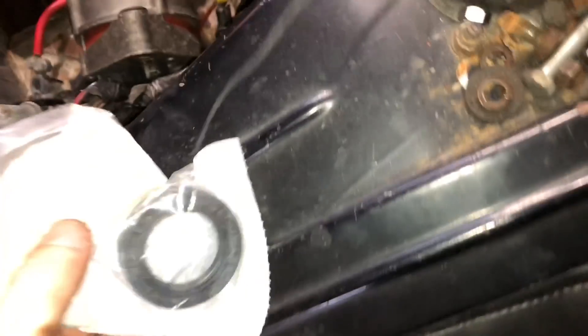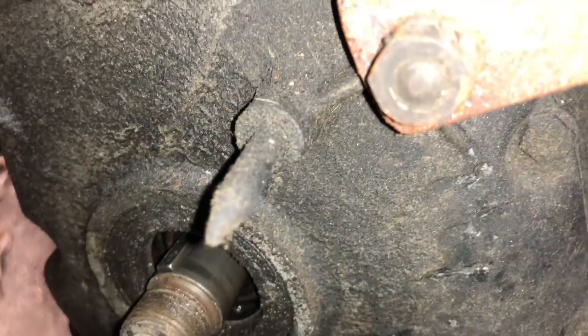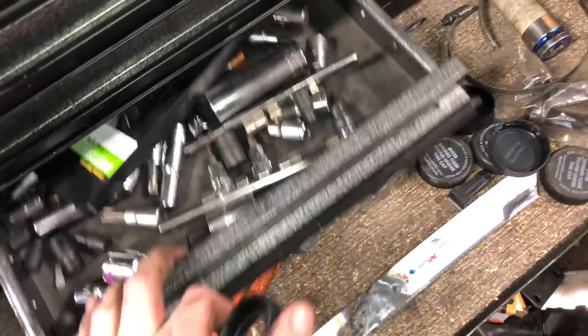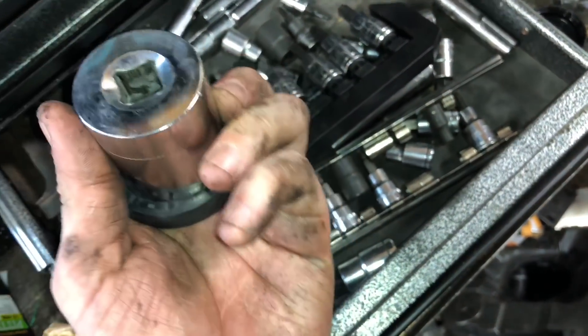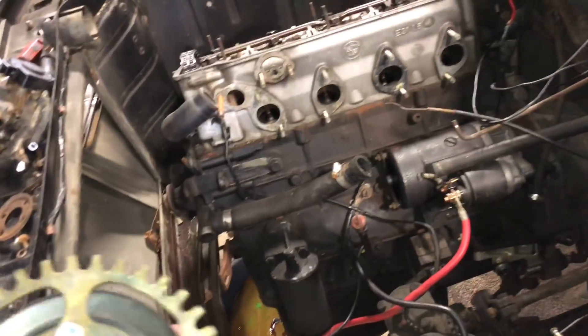There's that nasty old crank seal, and there's a replacement. So I'll do that real quick just so I can throw on the new crank pulley. Seal removed. What I'm going to do is find a socket of the same or similar size — hopefully a 36 — and use a rubber mallet to tap this thing in until the ledge is flush with the timing case. If I screw it up, whatever, I've got another one. And there we have it — pretty simple. Actually went in a lot easier than most seals that size on later model engines.